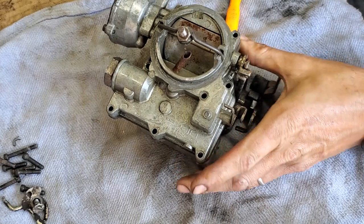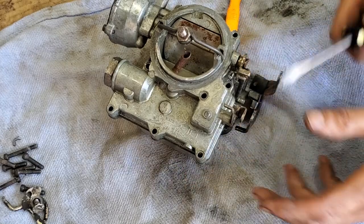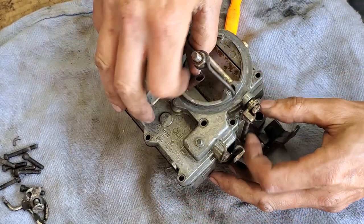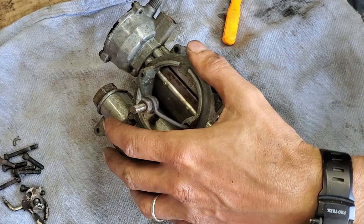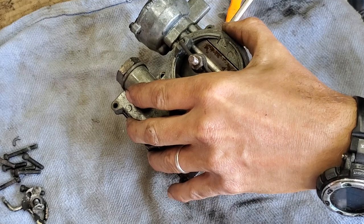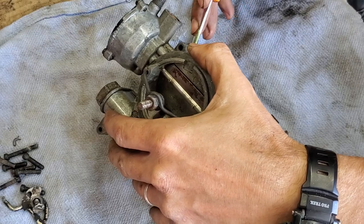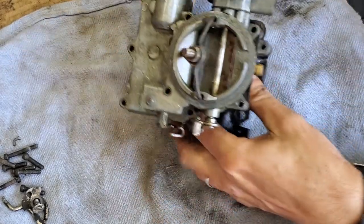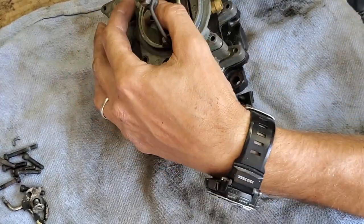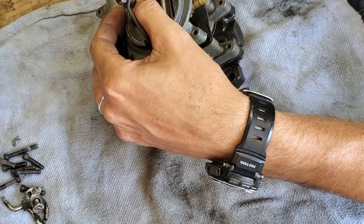For some reason this is not running well. I'm suspecting there might be water in the fuel. Water tends to sit at the bottom here and it just makes it idle terribly. I rebuilt this three years ago and it ran beautifully, but the guy just let it sit for all that time. The battery wasn't on a tender. Everything's dead. Naturally the gaskets always tend to get stuck halfway, but I guess we'll be putting a new kit in here.